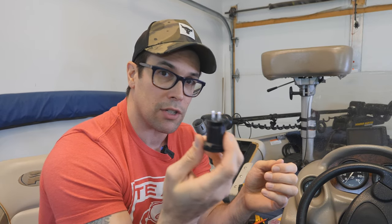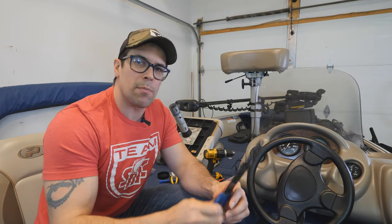I have a three-way switch on my boat — up controls nav lights and console lights, and down position is just nav lights. So that's the one we're going to patch into. Very important: you're on switched power, do not plug it right to the battery, and make sure you have a fuse. In my particular case, for just this USB port you'd want like a 5-amp fuse since it draws 4.2 amps — a 5-amp or 10-amp is fine. But since I'm patching into an existing circuit, I need to calculate total amperage from nav lights, console lights, and the USB port combined, and fuse accordingly.